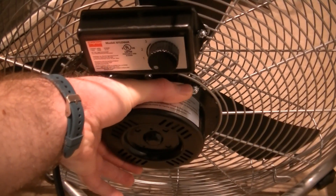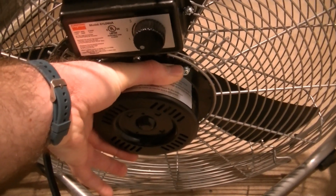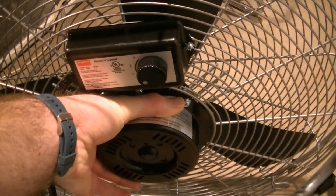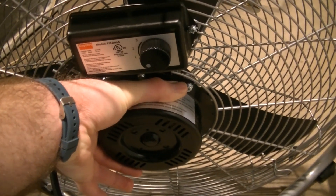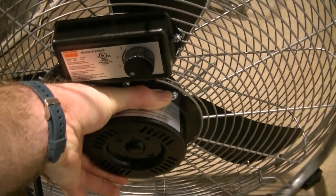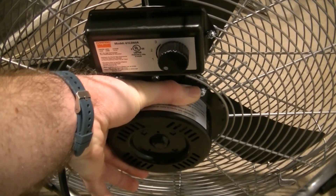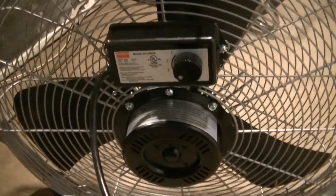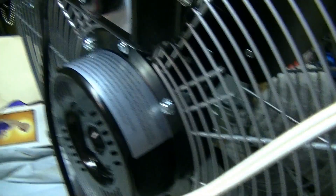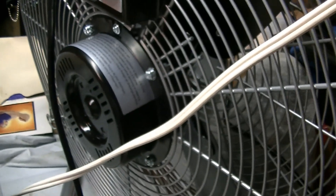There is a noticeable difference, but again, I think if the other one was overheating the thermal fuse would have tripped. With this stock fan, I'm actually going to attempt to put a capacitor in series with the low winding to quiet it down, and see how that works compared to the other one which is just pitched more. Stay tuned for that — it'll be a video someday. It is definitely running cooler. Just a matter of a few minutes and this motor is already feeling cooler, so it doesn't take long to cool down.